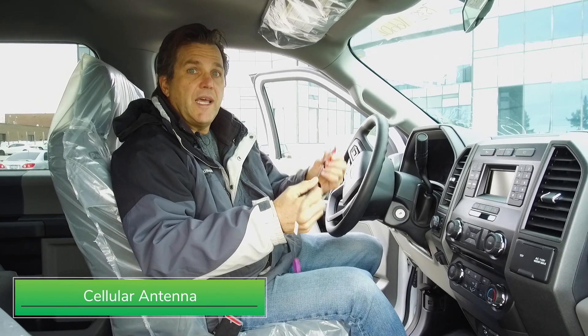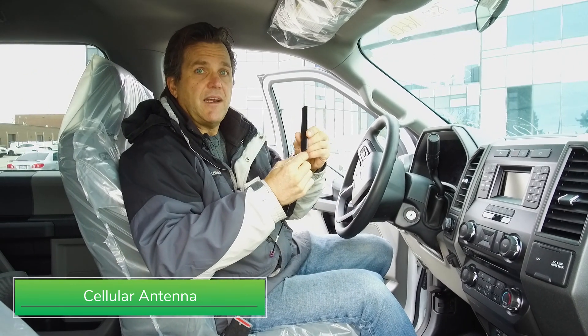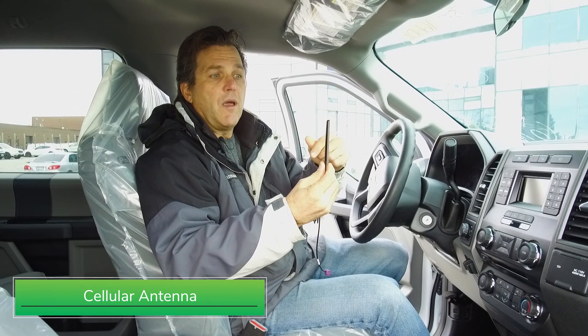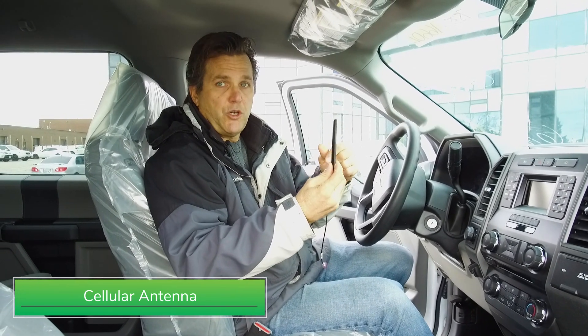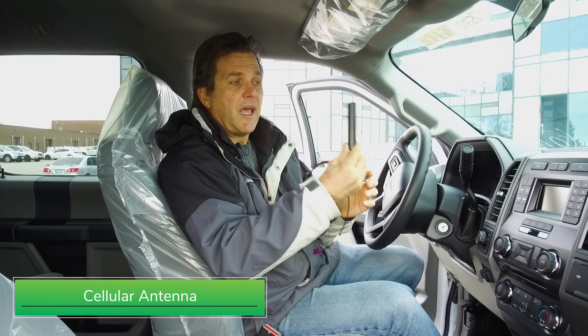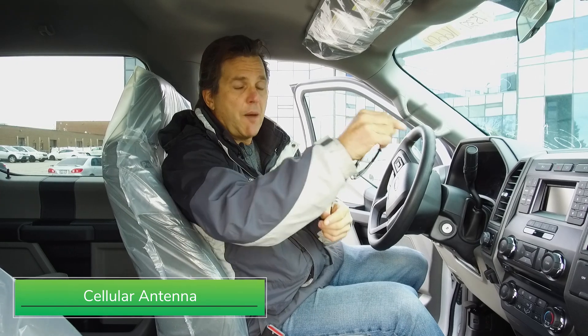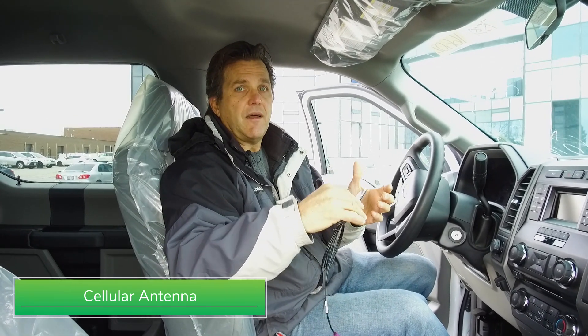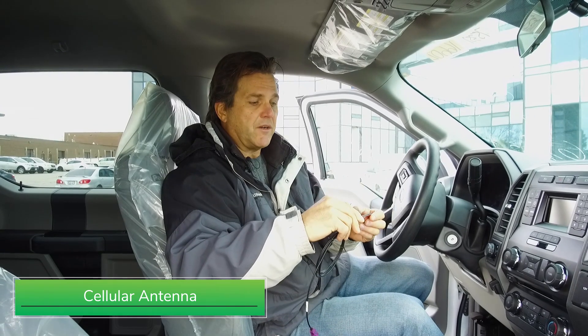What we need to do is placement of the antenna is making sure that it gets the full RF signal, placing it on plastic, which is a good thing. If we place it on metal, it only gets half of the signal, so placing it on plastic helps. You can put it either on top of the dash or under the dash, providing that it does not affect any operation of the vehicle.